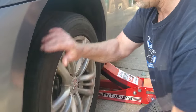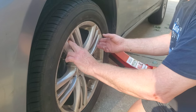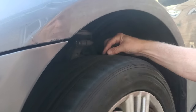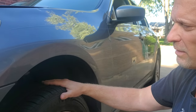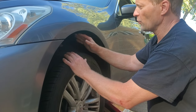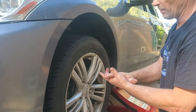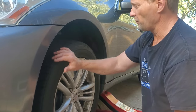Even though it's not a badly worn wheel hub — the bearings aren't frozen, you're not hearing a constant noise, and it's not stuck or anything like that. But I was able to lay underneath the car and I found a fixed reference spot on the car. Then I started rotating the tire and following the center tread, and the distance between that spot and the center tread seemed to vacillate — it seemed to wobble slightly. Now that could mean the tire isn't 100% perfectly round, and we all know rims and tires often aren't, which is why we balance tires. But in conjunction with the fact that 12 and 6 is moving and 9 and 3 is moving, and with the clunk I'm having — if the hub isn't seated properly and you hit a bump, it's always hitting. So it really seems like it's the wheel hub bearing.